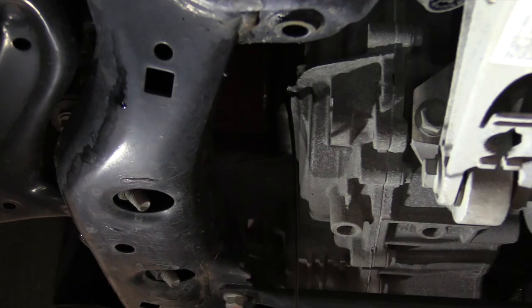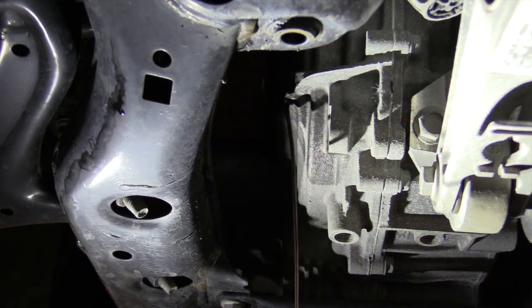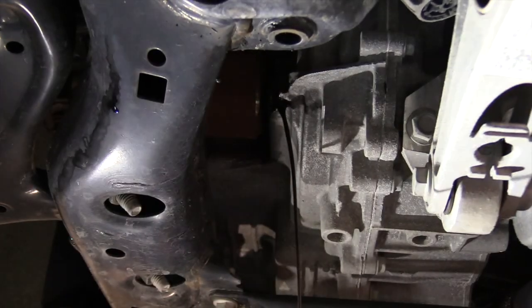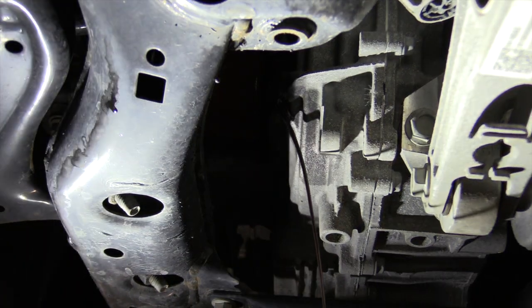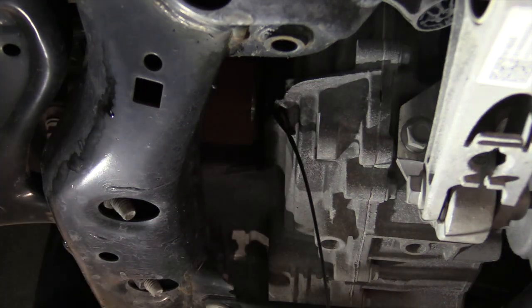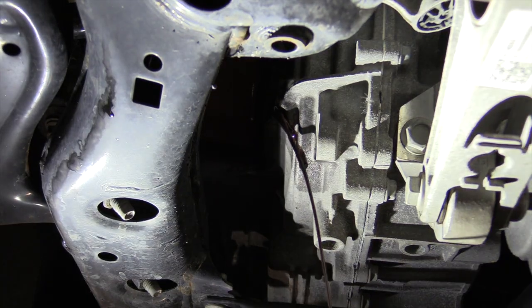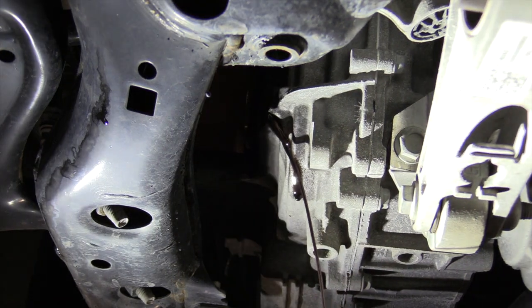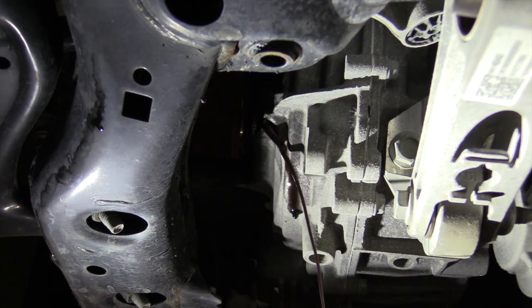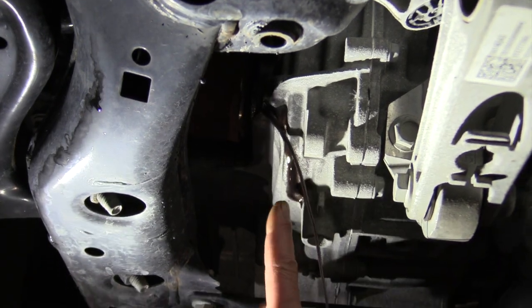I like doing this before I start on the transmission sometimes, just to see what's there and what the fluid looks like. And this stuff is almost a chocolate brown. It's really breaking down. This transmission is hard on the fluid. So this is one of those trannies with the Amsoil fluid. I do it probably about every 50,000 miles. If you're using the other fluids, I'd say probably about every 30,000, based on what this looks like, because it's kind of nasty.